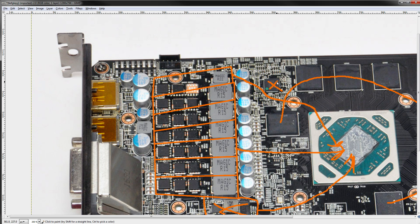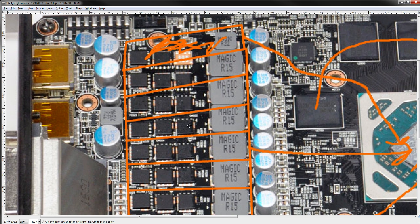It is a real six-phase VRM, using the IR 3567B voltage controller, which is the same for all RX 480 GPUs. This is a six-plus-two phase voltage controller, usually found fueling a six-plus-one phase configuration on the RX 480 — six phases for core voltage, and that last phase for the auxiliary VRM. All the voltages supplied by this controller can be controlled via software; auxiliary is what you find in the memory section of Wattman, and core voltage is controllable through Afterburner and Wattman.